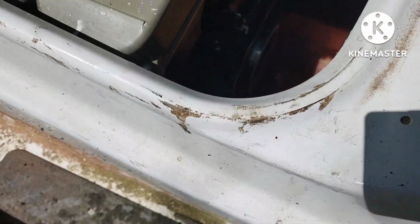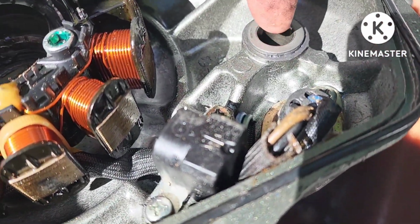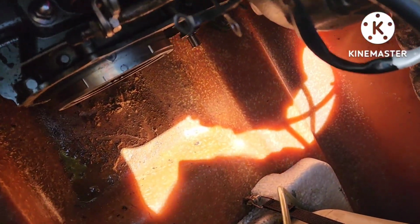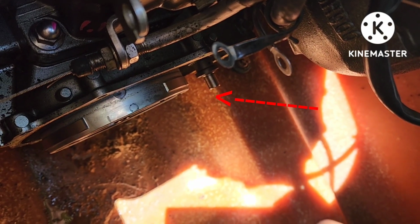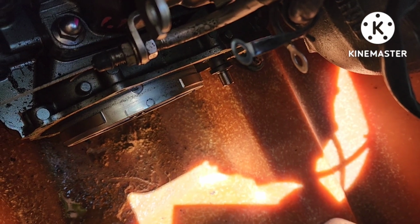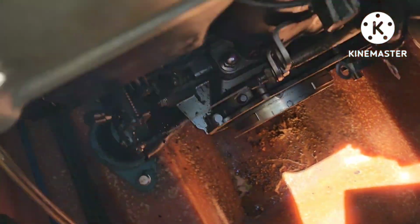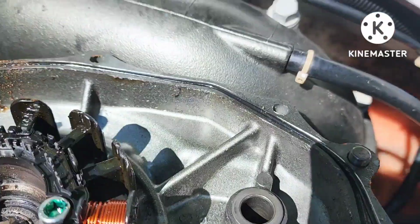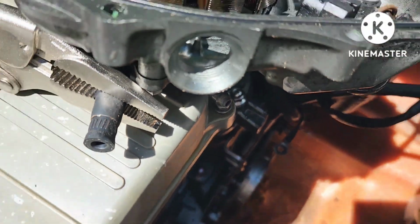And here is your spring and washer. They go on the front of your Bendix. The spring goes in right there, and then the washer goes behind it. It's easy to put the washer on if you just stick it on the Bendix post that's sticking out there, center screen, next to the big round flywheel. You just push the washer on there when you put the cover back on. Sometimes with this rubber seal, you have to put grease or sealant to keep it in place while you're trying to do this job, to put it back together.